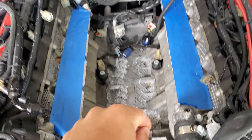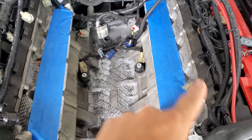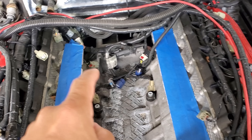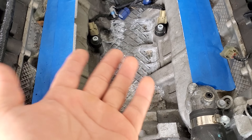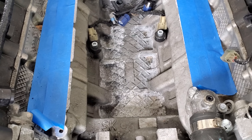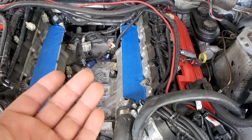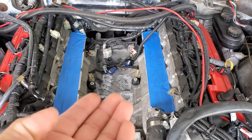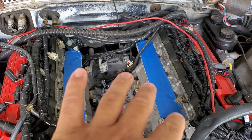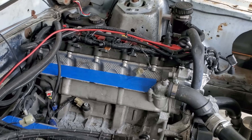New Predator motors have four knock sensors and they are individual, meaning they pull from each cylinder based on frequency. I believe 2018 and up Mustangs also have four knock sensors. On swap vehicles it's crucial to make sure the knock sensors are either properly pulling timing based on octane, or if it's a false issue.